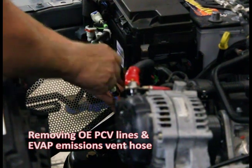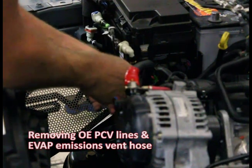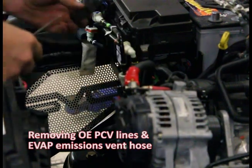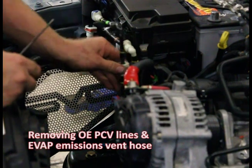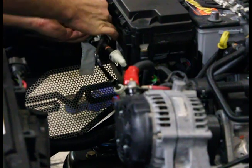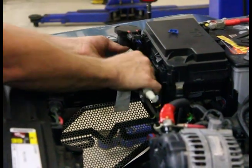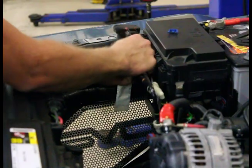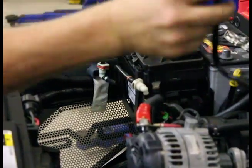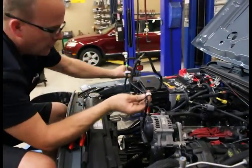I think it's this one here. Slide this pick, open that there. I'm going to take this off as well. This upper piece has the same connector as the fuel pump did. Undo the safety clip — real simple, comes right off. Push from the bottom and pull. This molded piece is going to be replaced by standard vacuum hose, more streamlined straight across to our vent control.